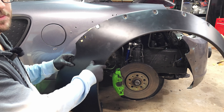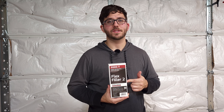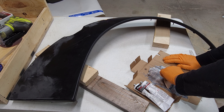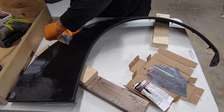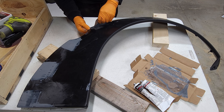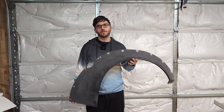The rear flares are going to be the same as the fronts, but this time I'm going to be a lot more generous on these places where I did the dimples. I've got the flares back in the heated garage, sanded down the excess epoxy, and now we're ready for filler. Polyvance makes this product called Flex Filler 2 — it's a fast-curing epoxy that remains flexible after curing, which makes it perfect for what we're doing today. It also works really well for plastic bumper repairs. It's just a two-part epoxy mixed in equal parts. Now the flare is filled and sanded.